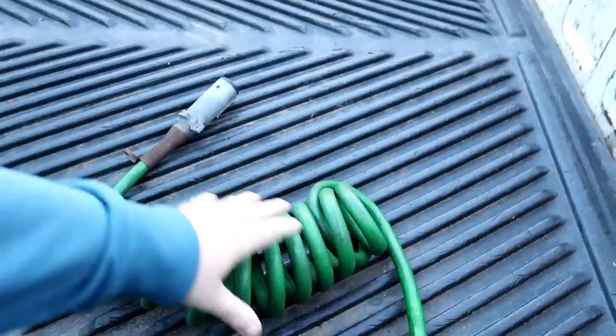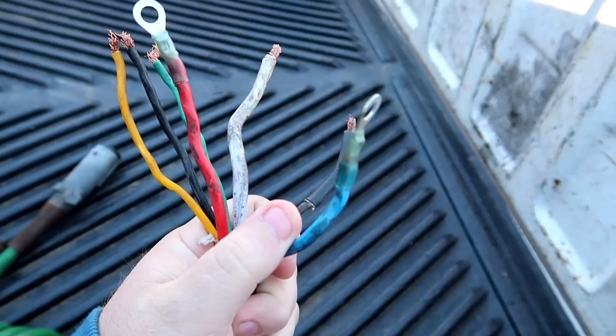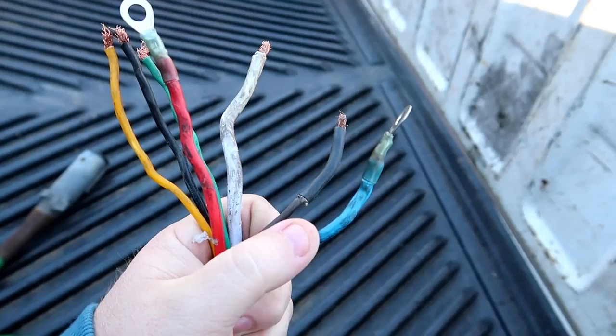Taking a pickup truck. You don't have to have this tool, but this tool works a lot better. It's not really even a tool, it's an old piece of equipment. So there it is. All it is is your cable going to your trailer. Cut the end of it off, and I put ends on them, blue and red. Red's power when you do this test, so it's gonna be power all the time, and you're gonna hit this for a second or 2 seconds or whatever, on and off, and it's gonna flash. And I'll show you when I get there.